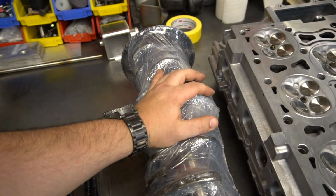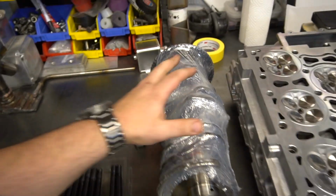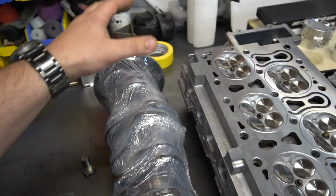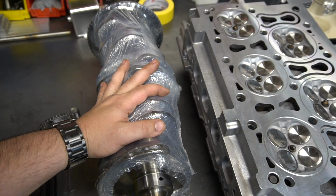With that being said, we did make some modifications to the crank. We are using a 12-valve, I repeat, a 12-valve crank. So Stav's really proud because now a 12-valve crank is actually going to be spinning and running. Well, no, I'm just glad that you're finally going to have a car that's fast. We are using a 2.8 crank to de-stroke the actual 3.2. However, the 24-valve 2.8 and the 12-valve 2.8 are the identical crank.